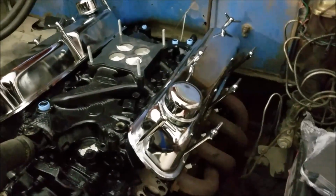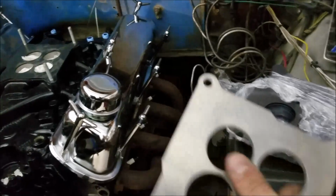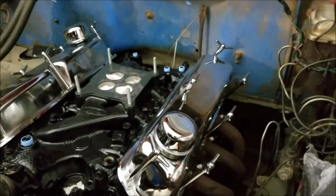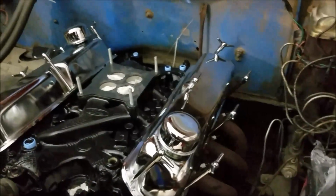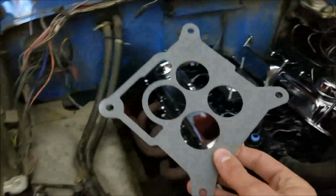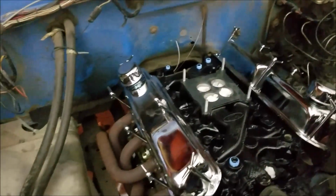One thing to consider with them is that little piece that sits off to the side. If you want to run a Holley carburetor, it touches over here where that port is. On the intake, I found out the normal Holley carburetor touches, so you have to run a spacer anyway, and that's why we came to these units. They're nice and thin and don't really mess with your stud lengths, so you can throw your old school base gasket on from like your 80s Mustang here, then slap this on, put a normal gasket, and run whatever spacer you want to run, and you'll be good to go.